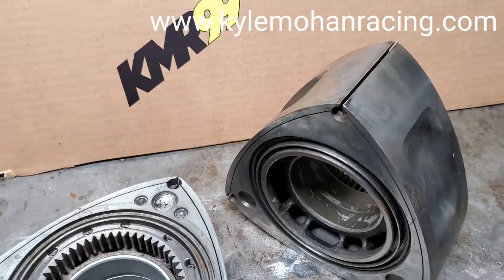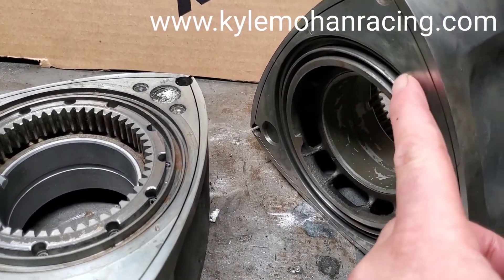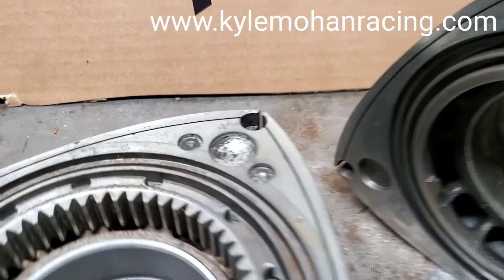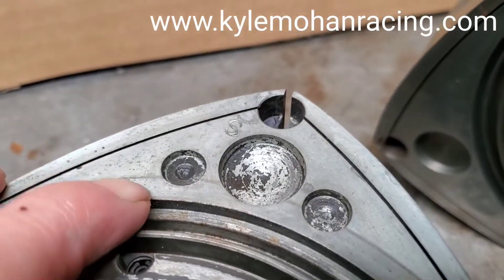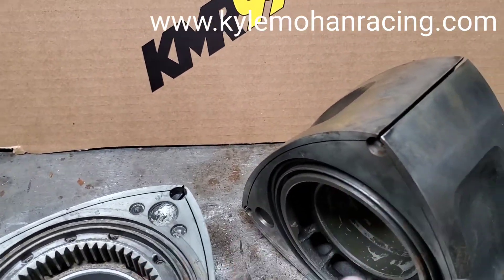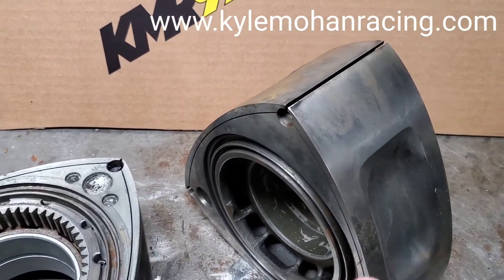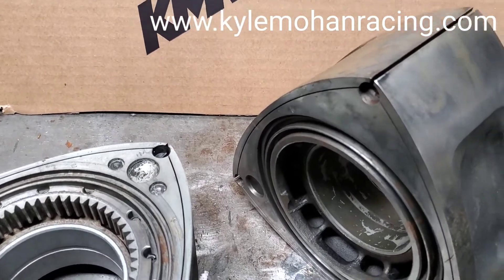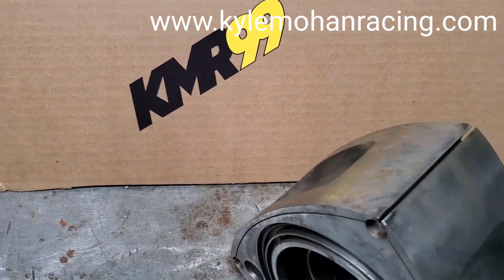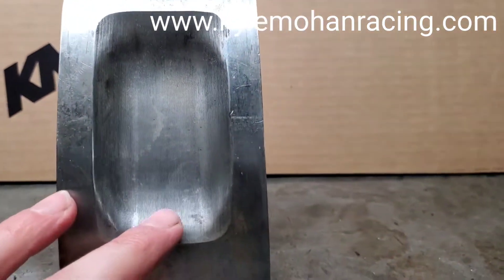On the early or original FD rotor there was not that ridge — the whole land area to tip area still has that five-thousandths change, but they ran the tips a little closer, and in a lot of motors you ended up with tip rub. So one of the KMR and Mazda Tricks recommendations is always tip clearance check when it comes to the rotors. Generally I do not recommend trying to match an early casting with a late casting.